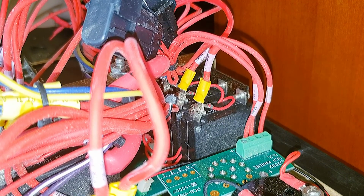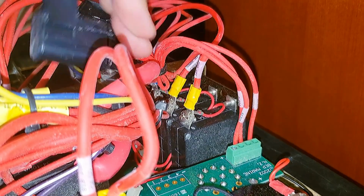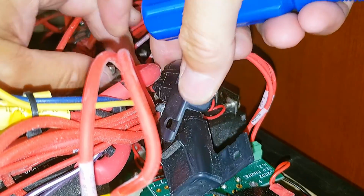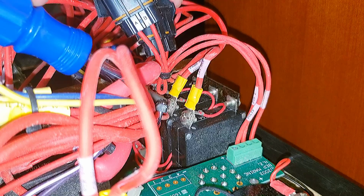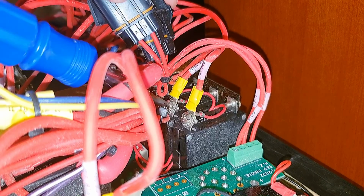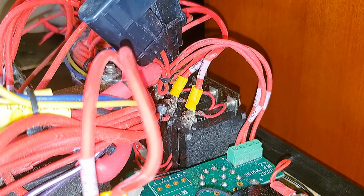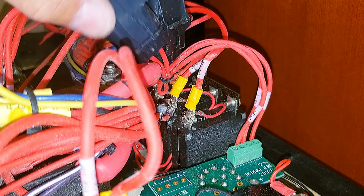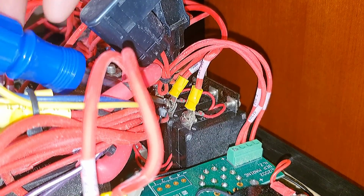All right, so I'm going to remove that wire. Shut that down, make sure we don't power through it. And this is the wire right here. Just got to be careful with everything else in here. You don't want to disconnect anything or short anything out. It's a little tight to work in. It's probably best to just shut the main power down as you're working around it. So you know what, I'm going to do that. All right, so DC mains are off. I should have done that at the beginning before I started. You don't want to drop a screw and then short something out.